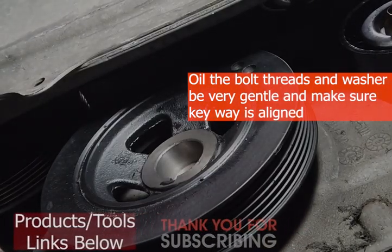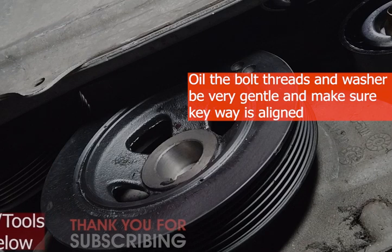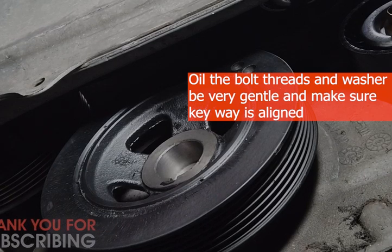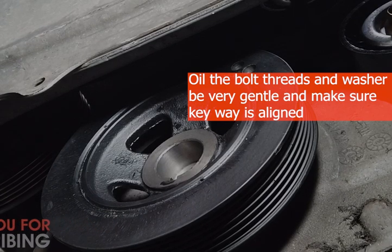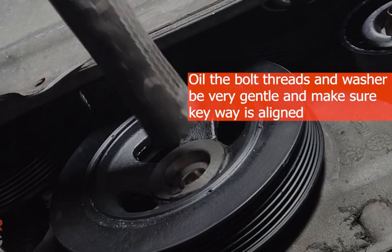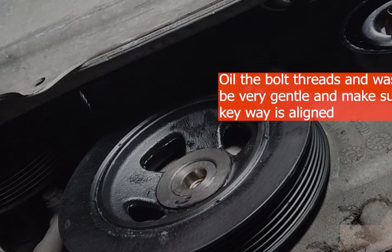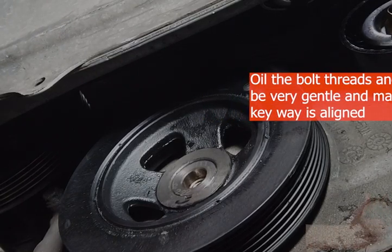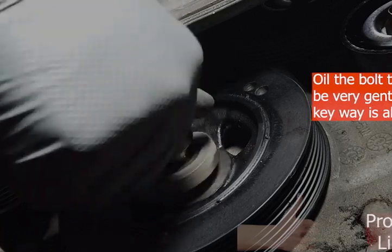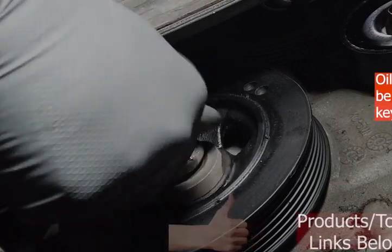See, the last thing we really want to do is make sure that we've made it past without any interruption into the seal, the rubber thing we just put on. And I'm just going to give it a little bit, just to see. There we go. See how it's very little. I didn't want to force it by using the bolt. But some people do, and unfortunately it can give you another oil leak because you ripped the rubber seal right back out of it. So you want to do that nice and gentle, and away it goes.